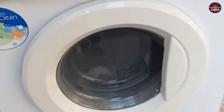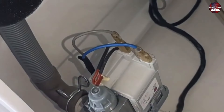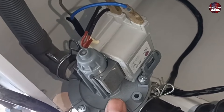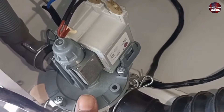What happened was that the machine took in too much water. When the machine takes excessive water, this problem can arise. Normally, if the machine takes excess water, there's a function that drains the extra water. However, if for some reason the drain system isn't working, this problem can occur. What you need to do is clean the machine's drain system as well to resolve the issue.